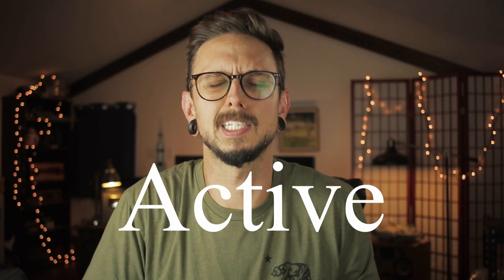Speaking of active, let's get into those. Active speakers have most, if not all, of the electronics that drive the speakers built into the enclosures. This actually has a lot of benefits, the most obvious being ease of setup and use. Most of the time, setup of an active system is simply plugging it into a wall outlet and connecting a source — after that, you rarely need to touch it again. Next, whatever amplification and audio processing is being done was designed specifically for those drivers in that enclosure. Really good active speakers have so much going on behind the scenes to increase audio quality — it sometimes seems like magic how such good sound can come out of a relatively small footprint. Although you can set up networking for a passive speaker system, a big draw to active speakers is built-in Wi-Fi or Bluetooth, and they're usually ready to go with wireless connections.